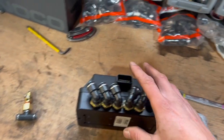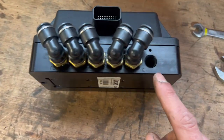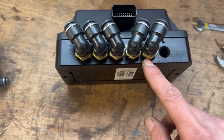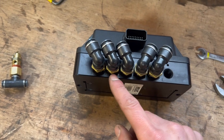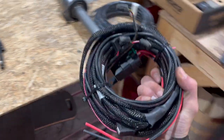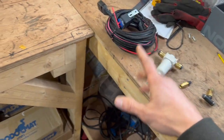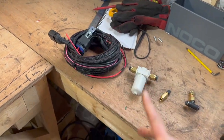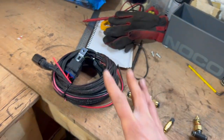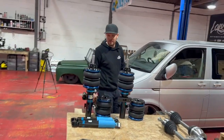So yeah — the manifold will all become more apparent when we get it mounted up. We screwed threaded fittings in instead of the usual push-to-connect, so we can come out at an angle. That one's the exhaust, that one goes to the tank, and then we've got front left, front right, rear left, rear right — and that is the brains of it all. Next up I just need to mess with the loom a bit. This is the Airlift loom which comes with it, but we need to put a second compressor loom into that, so we need to run a second relay and second set of wires.